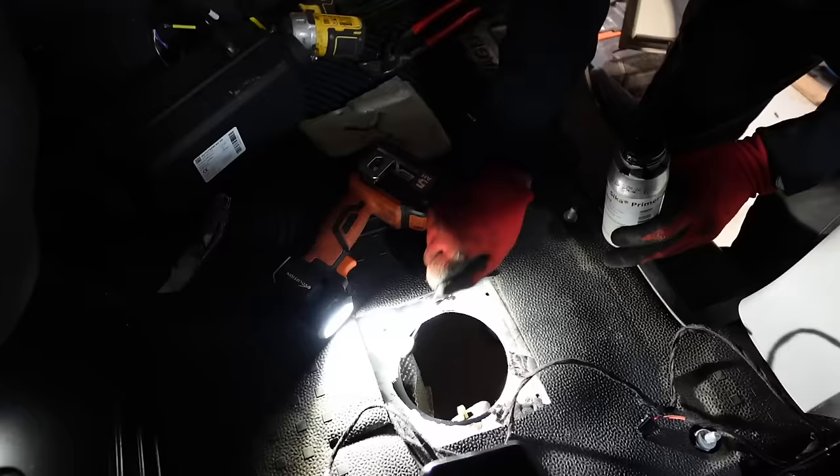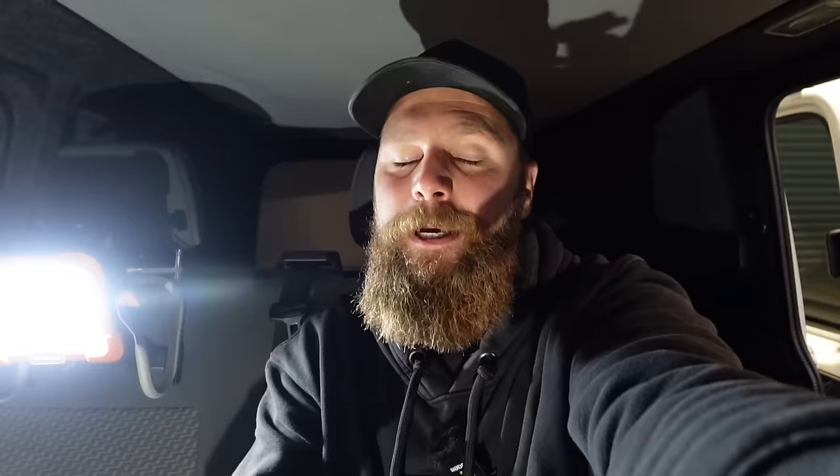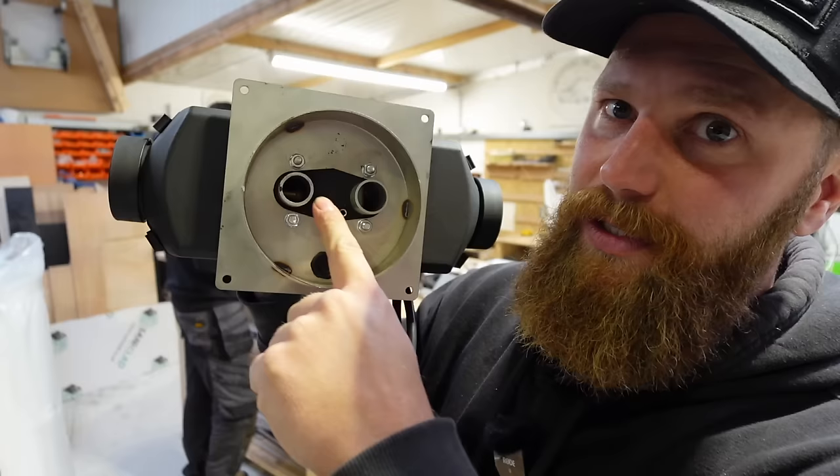Now that we've sorted the location and the turret plate's position, we're going to get that drilled out. Whenever you're drilling your van: drill your hole, deburr, file, clean the edges, and then protect them with some kind of primer or paint - Hammerite's pretty good. If you need to speed up the curing process, you can use a hairdryer or hot air gun. Make sure you do not leave unprotected edges.